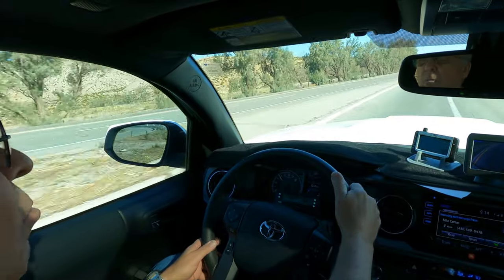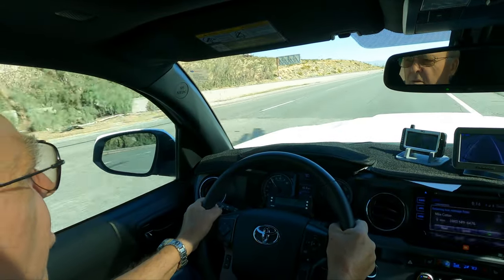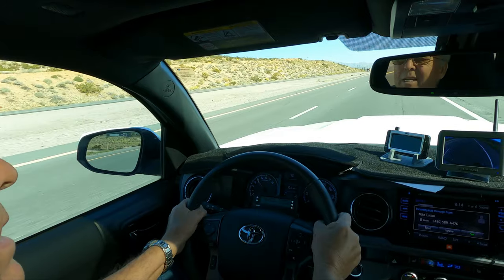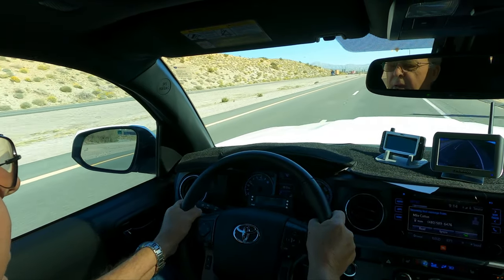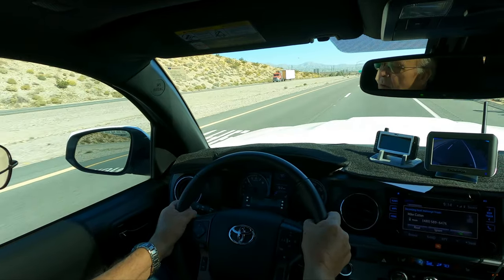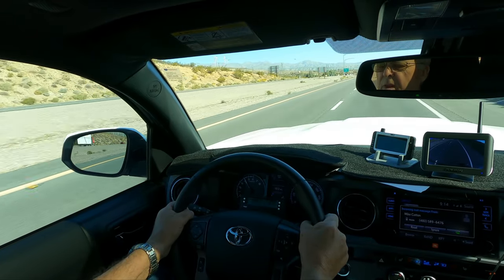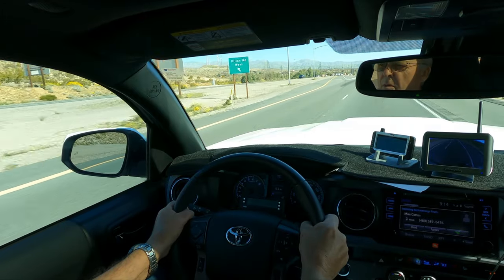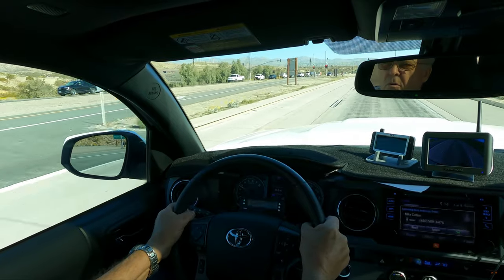The grade's getting a little bit higher now. We'll be heading up Highway 62 towards the Morongo Basin where I'll do my first pull and see how the transmission temperature does. Right now, we are pinned on the transmission and I'm running at 177 degrees. So far I'm pretty satisfied — we'll check back when we actually hit the grade.